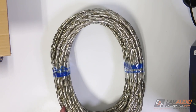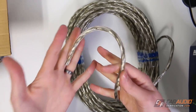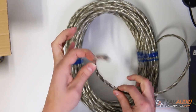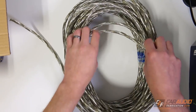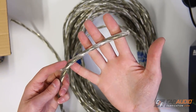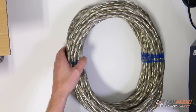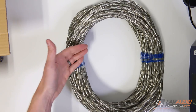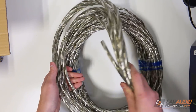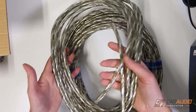If you think this is a lot, wait till you see the power wire. Next up — speaker wire. This wire is also twisted, it's nice and flexible, and it connects my amplifiers to the different speakers. This is 14 gauge wire for all of my speakers. And this wire here is slightly larger — 12 gauge wire for the subwoofers. This is the Karma wire. This is 150 feet of wire. You'd be surprised how quick it goes when you have to connect to crossovers and then to eight different speakers. And this 12 gauge wire for the subwoofer — I picked up 20 feet, which will probably be more than enough, but if I have leftovers it always comes in handy on a future project.